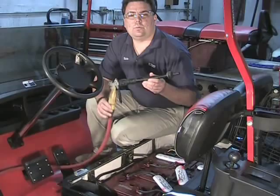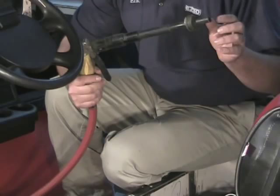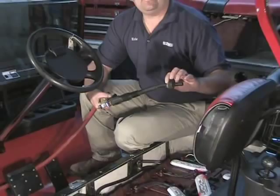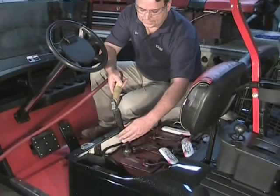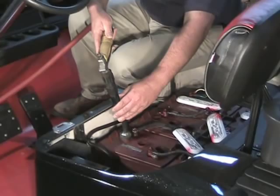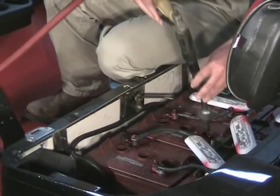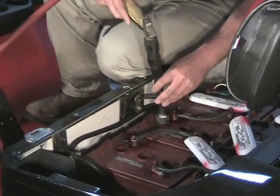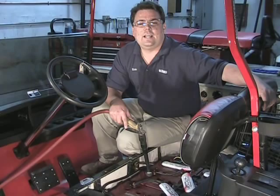The watering gun simply connects to your garden hose and is an automatic shutoff gun. It comes with a poster that tells you what length from your stoppers to the end of the tip should be. We use a band clamp, so once we get the measurement right, we lock it into position. You then put the gun into the battery hole up to your stoppers at your measured length and pull the trigger. As the battery fills, the gun will click off — just like a gas pump filling your car. You go from battery hole to battery hole. It takes anywhere from five to ten seconds per hole, and you know it will be filled to the exact level, which cuts down corrosion, increases run time, and gives your cart better overall performance.